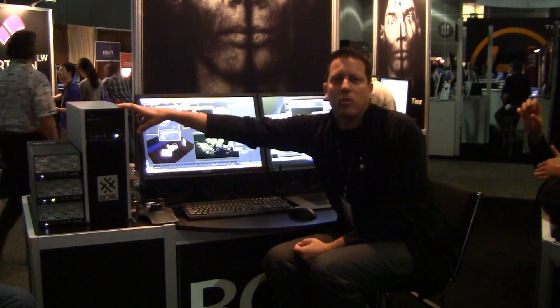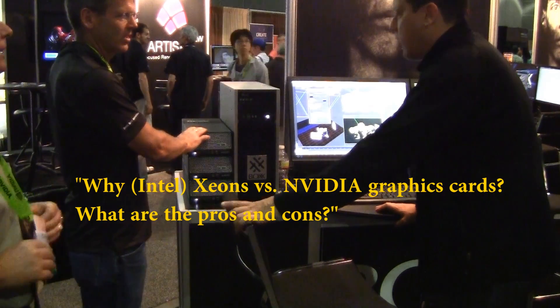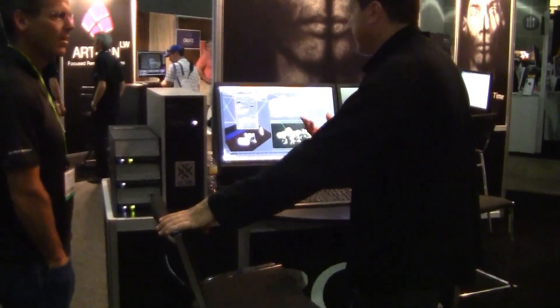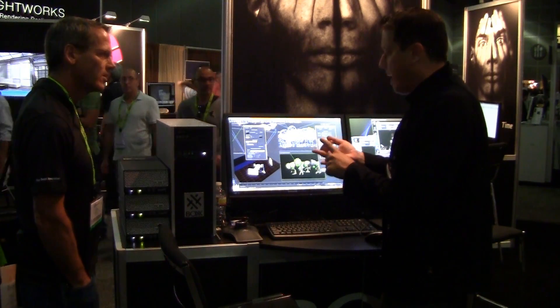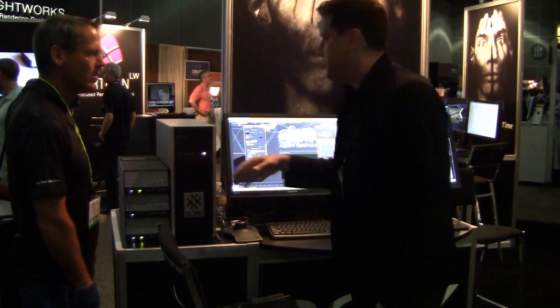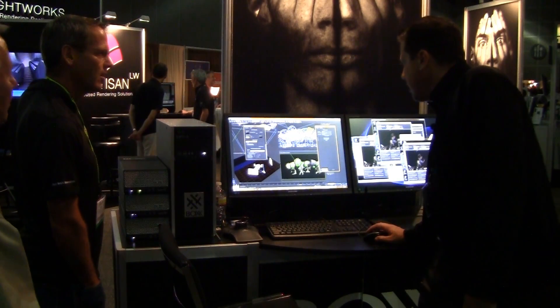We're also using a GPU board set inside of this workstation for GPU hardware accelerated rendering. Why Xeon versus NVIDIA graphics card? Xeons are for software rendering, ray tracing, and things like MentalRay. In the case of 3ds Max, we've got several different rendering engines. The Scanline Renderer and MentalRay are both software renderers. We also have a Quicksilver renderer and another one called iRay, which this scene is set up for, and this one takes advantage of the GPU.